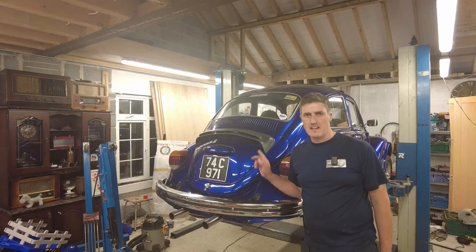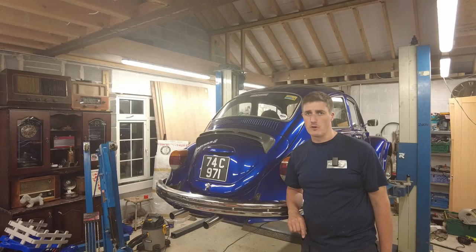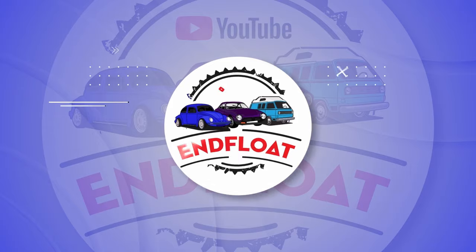In this video, I'm going to be replacing the accelerator cable and the accelerator cable guide tubes in this 1974 Volkswagen Beetle. You might ask why I'm replacing the guide tubes as well as the accelerator cable. Well, the accelerator cable is not actually broken in this car — it still seems to be okay, but it's binding all the time. I personally think the reason it's binding is because it's catching inside a frayed guide tube. There's a bowden cable that goes up beside the gearbox, and then there's a tube that passes through the fan shroud. We'll be replacing both of those. Let's get stuck in.